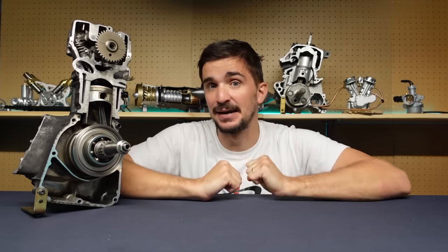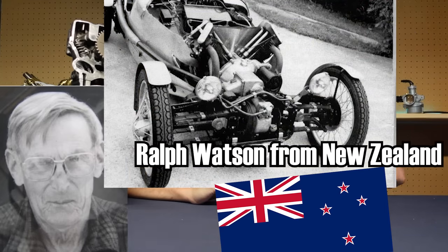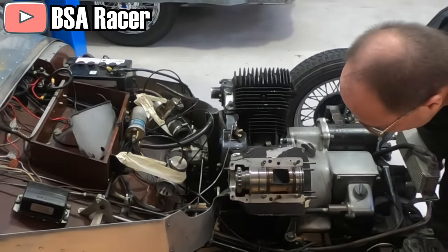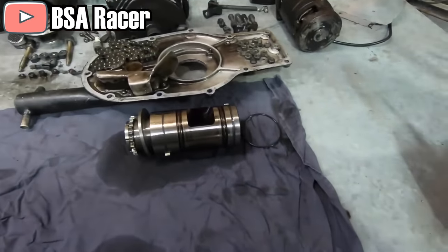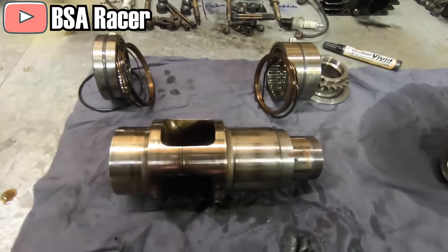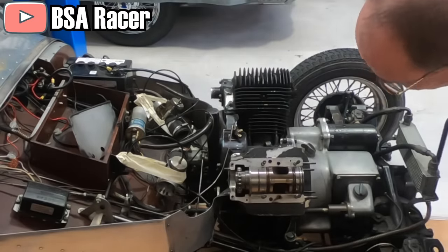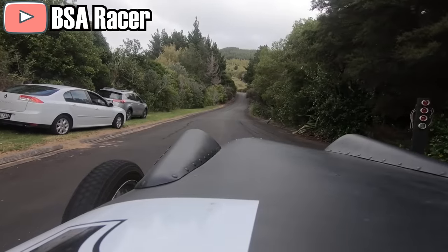But as I said, it's not impossible — and in fact, it has been done. A man by the name of Ralph Watson has built and operated an engine with a very similar system to the one I'm showing you here, successfully, and raced it successfully since 1989. What Mr. Watson did was make a custom rotary valve system for a British BSA 90-degree V-twin engine. His system employs conventional material O-rings together with wavy rings, additional bronze seals, and spring-loaded levers to ensure that the O-rings perform as they should during engine operation and that the valve remains sealed. The rotary barrel sits on oiled bearings and has overall proven itself as an effective and reliable system, used and raced extensively for several decades.